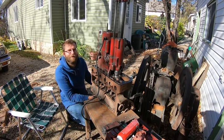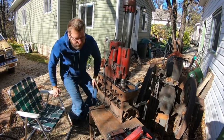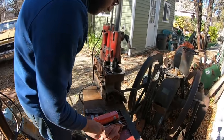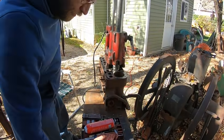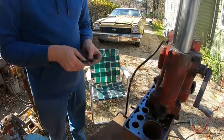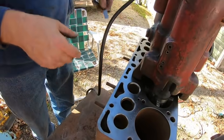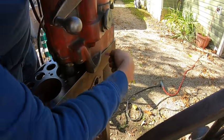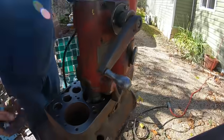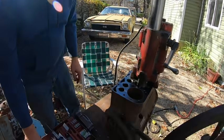This block the old man ran in the late '50s — remember that cut-down sedan? Yeah, this is the block out of it. So I mean he had it for a long time. Now, just for safety and paranoia — that's our spin. We'll take a thou and a half feeler gauge and they don't go underneath anywhere there, and they don't go underneath anywhere there. So by rights, as long as the boring bar cuts square we should be good to go.